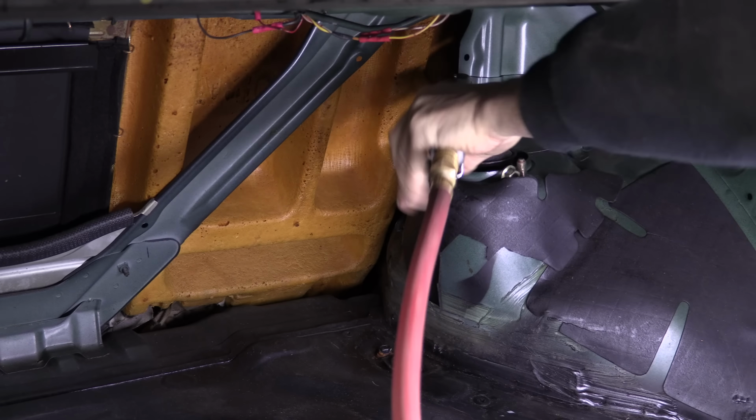Okay, sorry, had a little problem with the battery there. Got the other control arm off. There's still four 12mm bolts holding the ABS sensor wiring to the subframe that I didn't bother to remove because they weren't bothering me until now. Truth be told, the more I touch them, the more they bother me because I know that I'm going to have to get them out of the rear hubs without destroying them soon. I won't feel better about them until that happens.